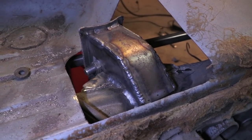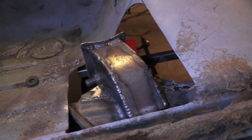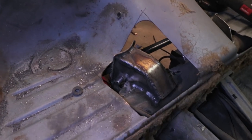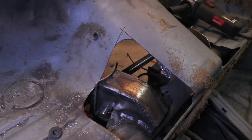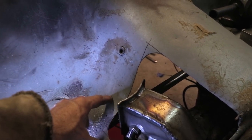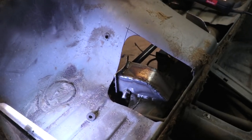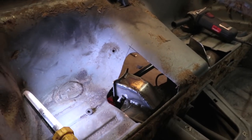I haven't ground down any of the welds and some of these will be visible from the inside, so I'll probably spend some more time just smoothing this so it looks like it's made of all one piece. But this is in for good. I do have to do a little bit more welding and just a little bit more trimming for that bolt clearance. It's going to be interesting to see what I come up with on how to seal this big hole — I left the panel I cut out and I'll be using some of that. It also probably needs to be channeled a bit right here because I think the banana arm is going to contact this if I use the highest hole. I'm obviously not going to be using seats back here. I'll have to definitely create a seal because I can't have fumes coming into the driver's cabin.